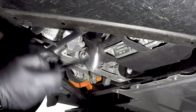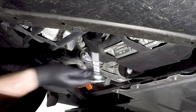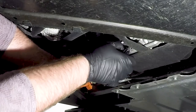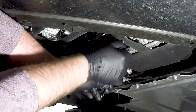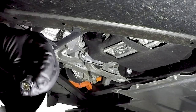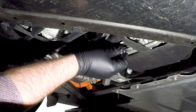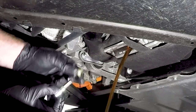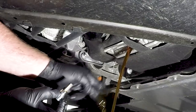Back with a man-sized ratchet, just got the 8mm right here. Let's see if we can get this loosened up. There we go. I do have the filler cap up top still in, so it shouldn't gush too bad. Let's get this off and see how bad the splash goes. Wow, the oil looks really clean. Super clean. I don't think this Rex got a ton of use, which is fine.